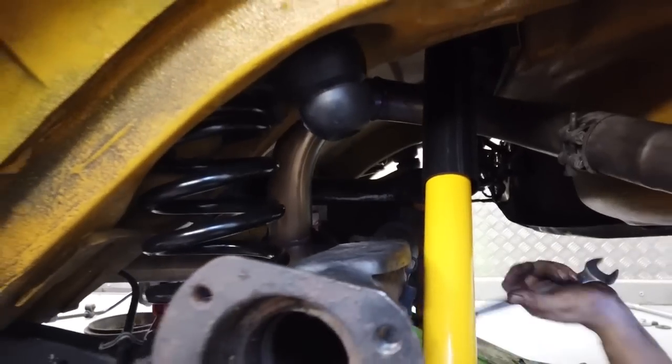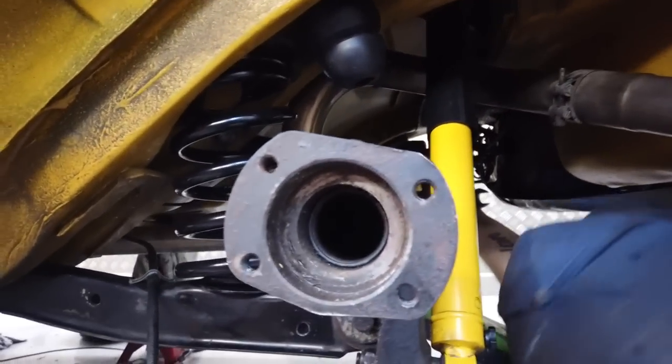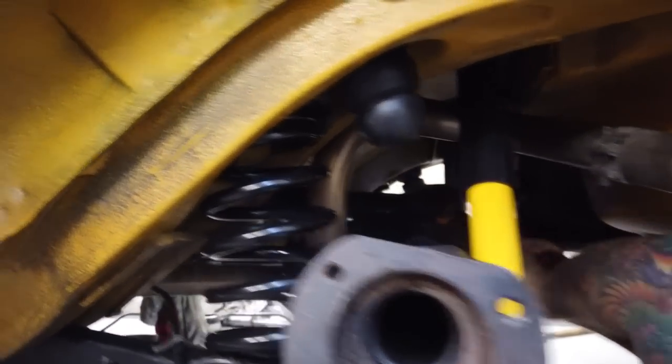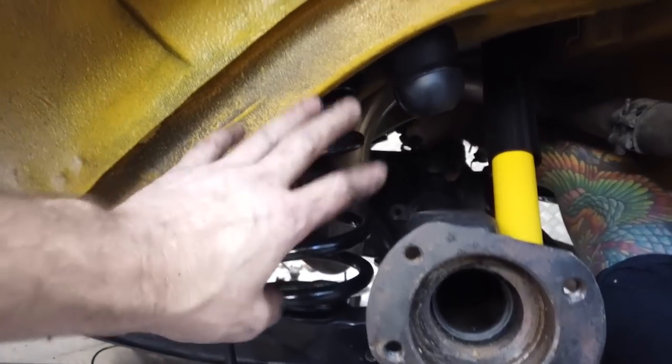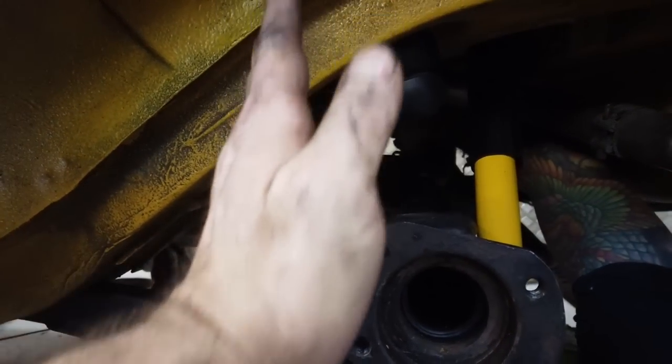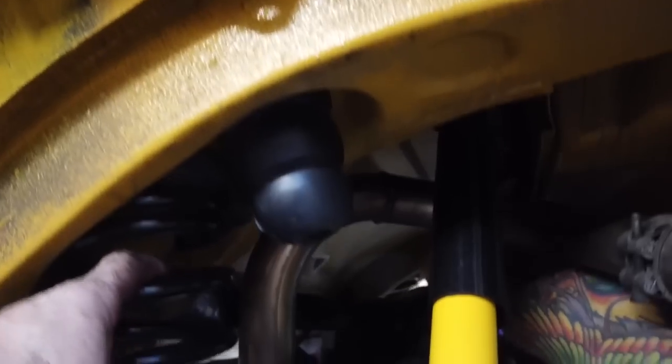We're now at the reassembly of the axle stage. We've positioned all the nuts and bolts in. It's easy to have your springs loose as you offer the axle up, otherwise it's hard to get the spring to go into its seat at the top of the socket of the chassis fork. So have these springs here wobbling about, and using a jack, you can jack the axle up into position. Everything lines up pretty easily.